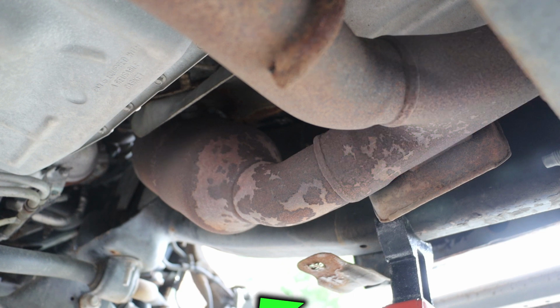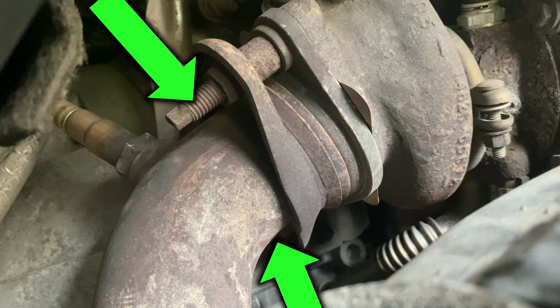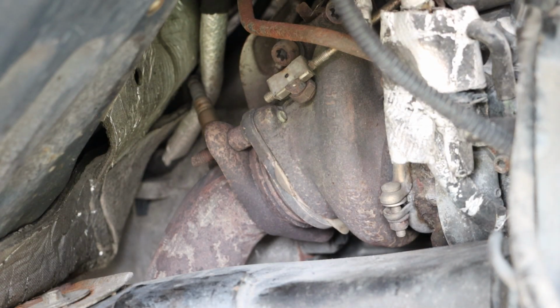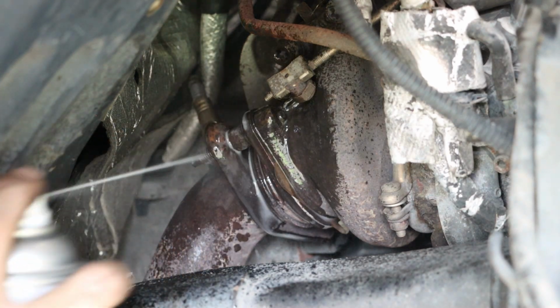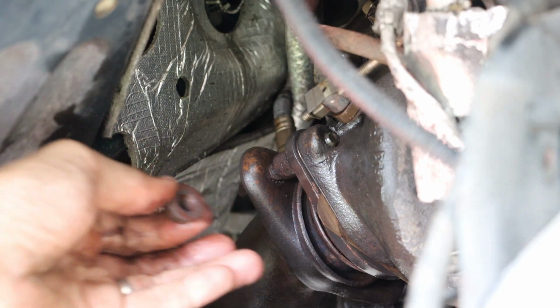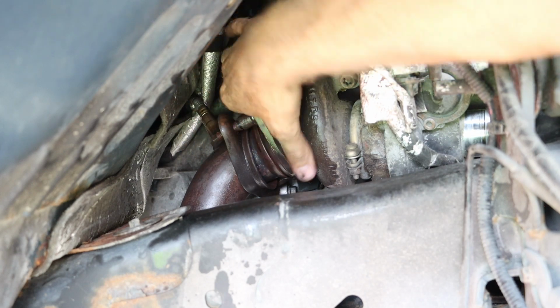We are looking at the connection point between this exhaust system pipe on the passenger side and the turbo. And this connection point does have two studs with nuts on them holding that on. Because this is an exhaust system, we will want to coat this with Amsoil metal protector to help remove those fasteners. And that fastener on the backside does need to be accessed from underneath the vehicle. And our bracket is loose, but it does get caught on our sensor.